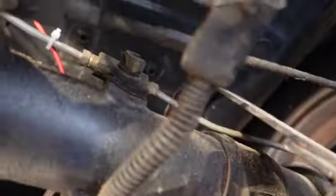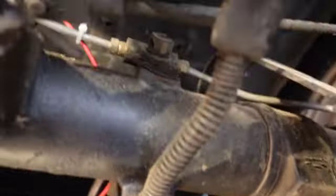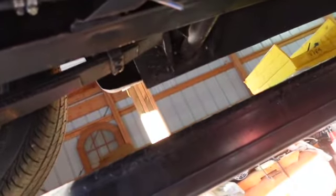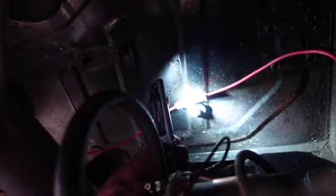I don't know which way's better. And then I'm following the brake hose. This axle doesn't move very much, but it does. So then across the axle cover, and then across to the other side, and I found a clip just sitting there. I didn't put it there, but I'll take it. See that clip right here? So I used that, and I put some silicone vacuum line there, and then I came down to there, and then I made a new end, and it's on there real good.